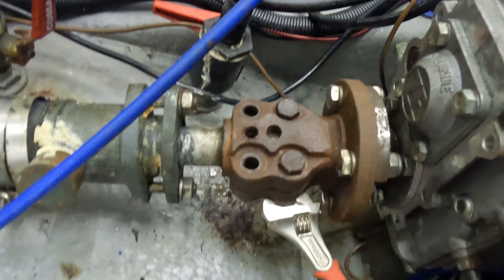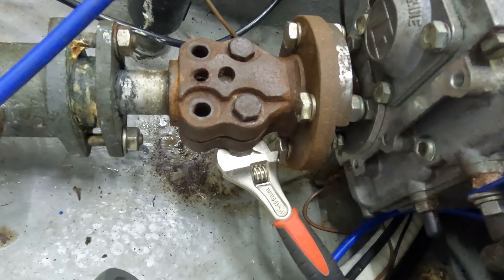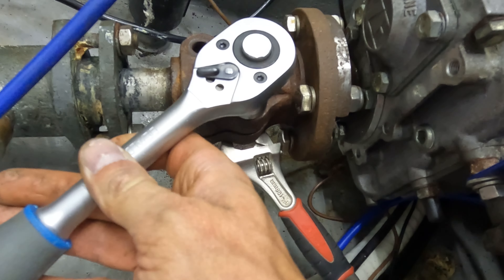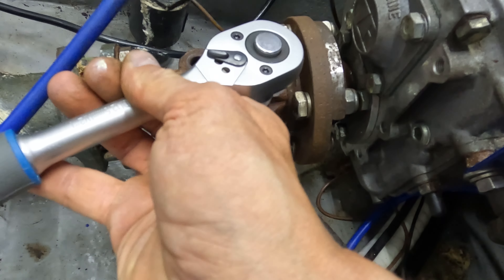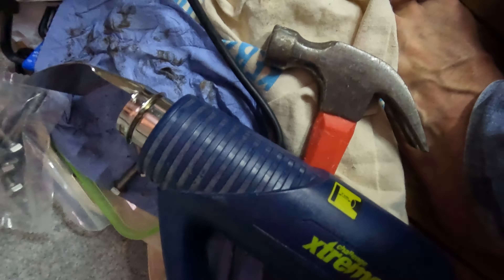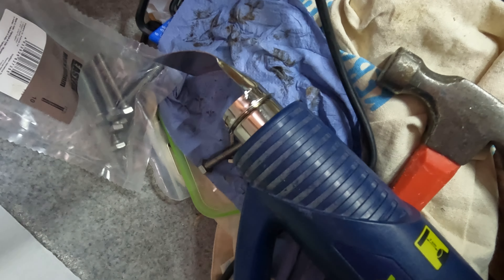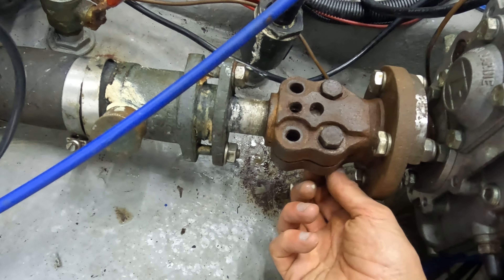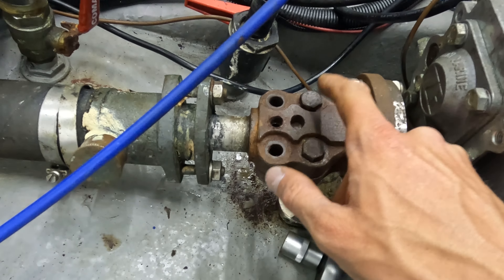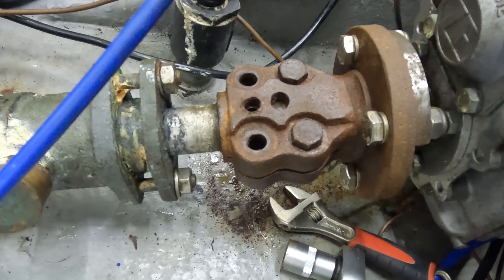Okay guys, this is what I've resorted to. One bolt with a spanner trapped on the underside and a socket wrench on top. It's finally come through with a combination of the penetrating fluid and the heat gun — I left the heat gun on it for two or three minutes on the low heat setting, turning it off intermittently to slowly warm it up, and finally this bolt is coming out. The last one I can't get to move at all yet — it's even more stubborn. But three — well, four down, one to go.